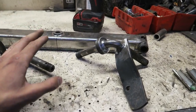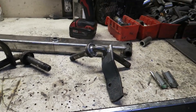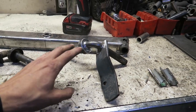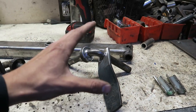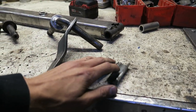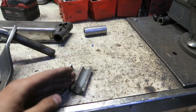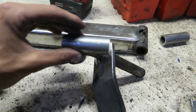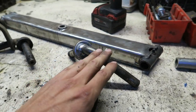The first thing you need to do to any off-road mower you're putting big tires on is reinforce the spindles. This area tends to bend or weaken over time and can cause real issues out on the trail. I took some 0.120-wall tubing, cut it in half, bent it into place, and put it on the back side of the spindle so it reinforces the whole spindle. It can be welded on the front, both sides, and each hub side.